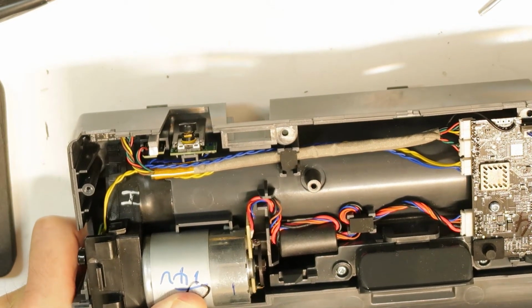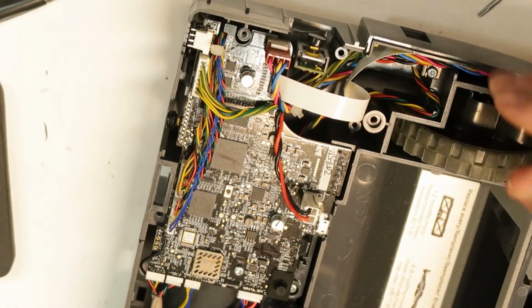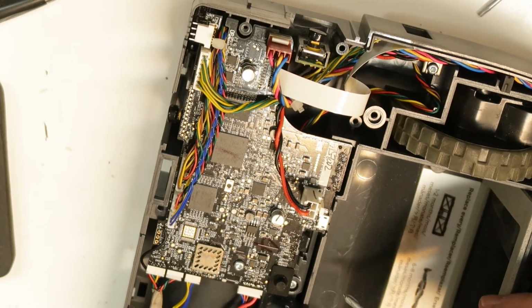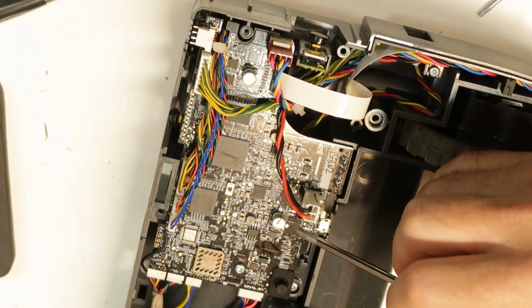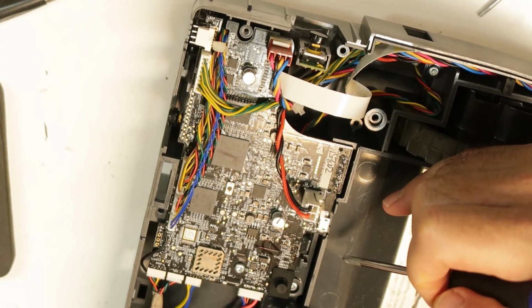And that's all. And after looking at everything here, I decided that my problem is too complicated. I don't have schematics and I cannot fix it at this time. Also, you have, of course, some DC to DC. I have measured 3.3 volts here, so of course the microcontroller is working. Also, I can see the LED lights.